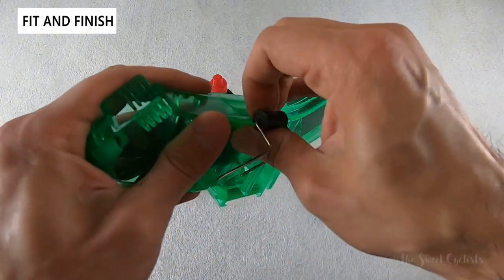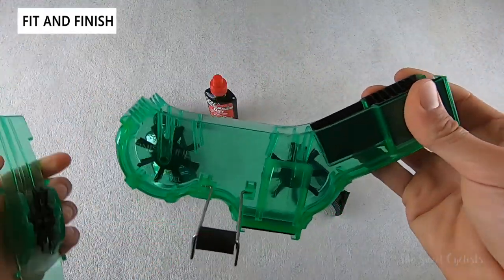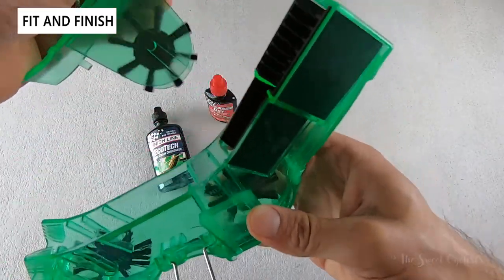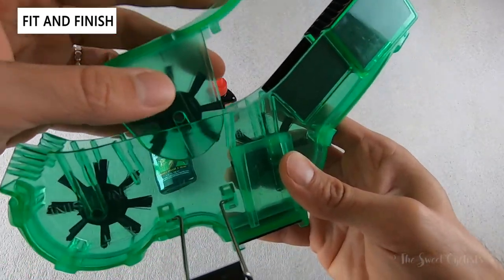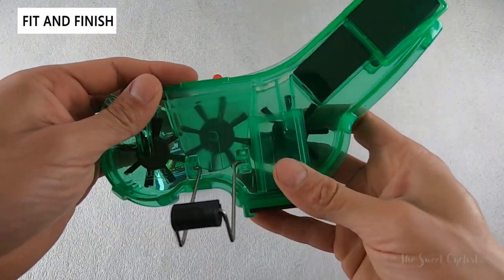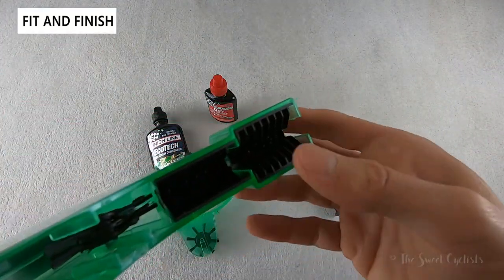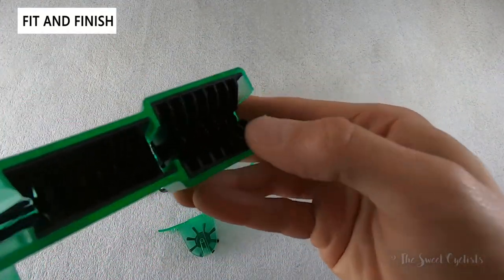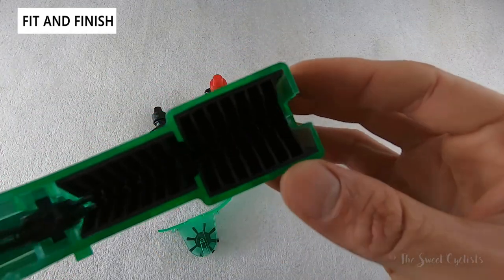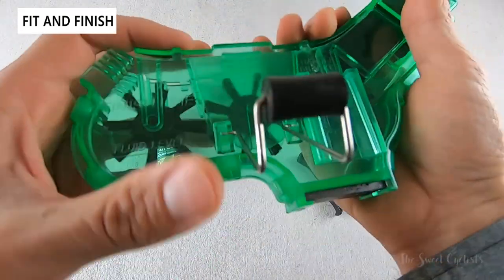The top is held in with a little wire holder — pull that off and you can pull the top off. When you install this on the bike, you pull the top off, place the chain in, and you can see the middle brush is actually attached to the top, so when you put it down it forces the chain down and through the two different brushes. The scrubber pads have little ridges on them that help prevent any fluid from coming out and clean the edges of the chain as well.